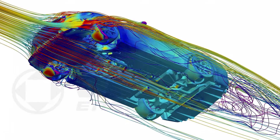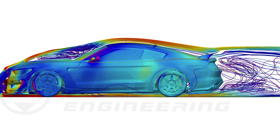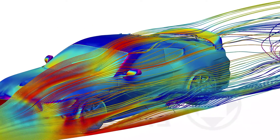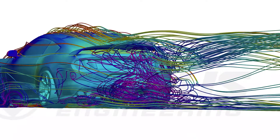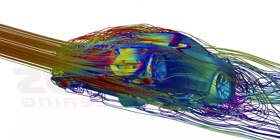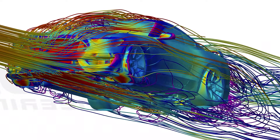The flat underbody panel kit and the turning vane kit is part of the Ventus One kit for the GT350R. The entire reasoning behind the Ventus One kit was to reduce drag for the factory GT350 and GT350R. By cleaning up the underbody and adding a flat underbody we're able to reduce drag. This creates a strong vortex which actually improves diffuser function and creates more downforce.